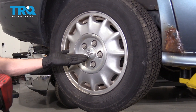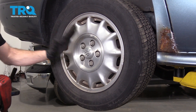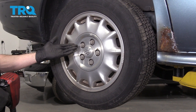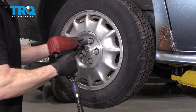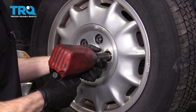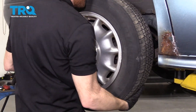Okay friends, it's time to get started on our job. One of the first things you want to do is safely raise and support the rear of the vehicle so the wheel's off the ground. After that, let's get these plastic covers off and use our 19 millimeter to remove all five lug nuts located behind them. Remove your wheel.